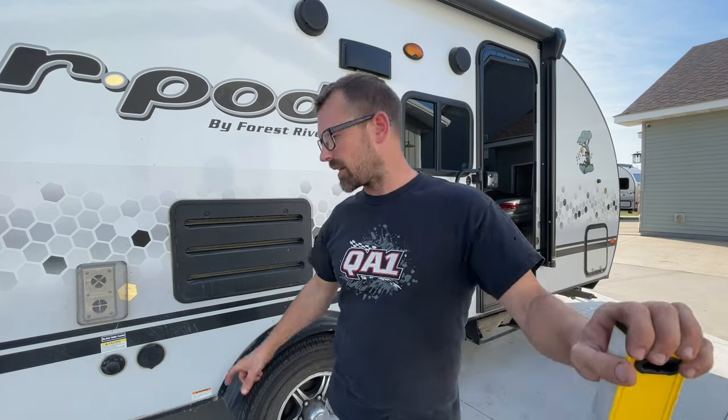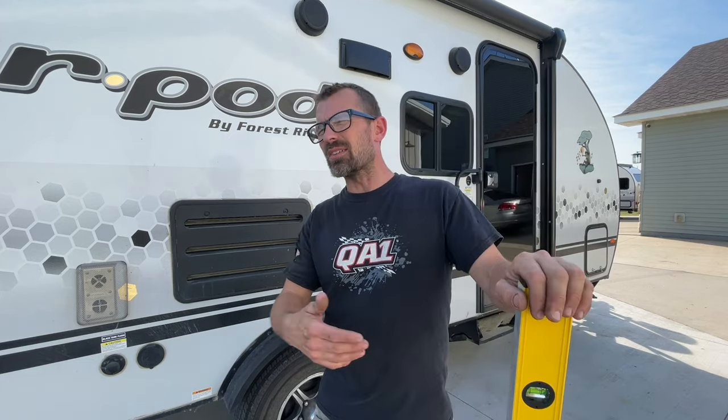And then she also says, well, have you thought about putting outriggers on it? And outriggers are something that would bolt from the frame to the axle further out. Because right now the frame's inboard a little bit, so there's a little bit more force on that axle assembly. So then she also recommends doing that. I don't know if that's covered under warranty because that's some modification. I don't know. It's all over the place. And I just hope that this isn't a yearly maintenance item that I have to replace.